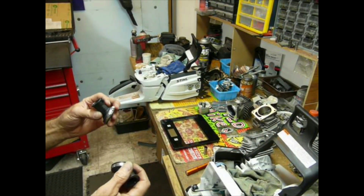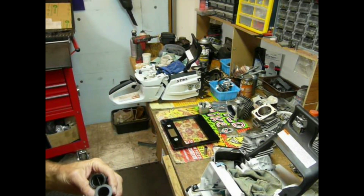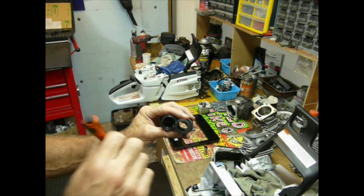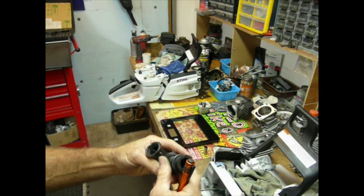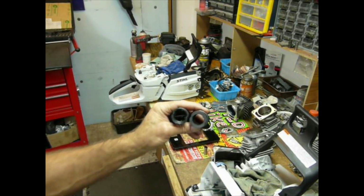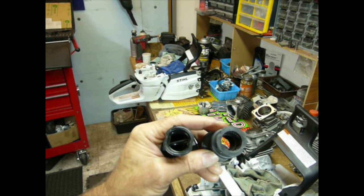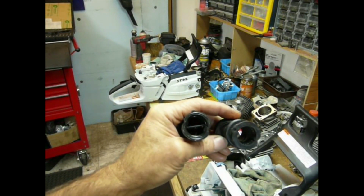We're relatively close to the same in the concept of the intake manifolds. They both have the little ridges in there, but they only have the ridges in where the air and fuel mixture. They don't have it on the stratification side in the 462. It's all encompassing because it's all charge going in the 461. Now you can see there's quite a bit of difference in there. The way that's designed, more flow capability here. That's why I say the 461 is going to spank the 462 in built form for sure.